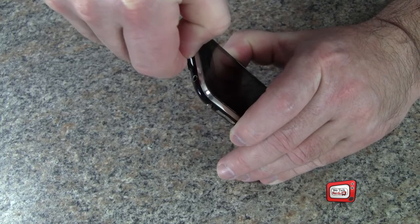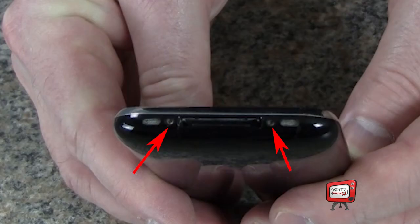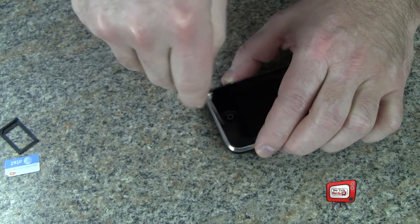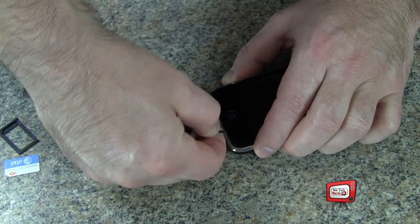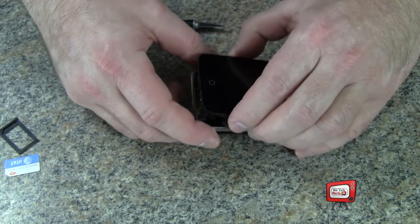Before you begin, you should back up whatever data you can. If you normally sync your iPhone to your desktop using iTunes, do that first, and then power the device all the way off. You start by removing the SIM card with a straightened paper clip — the SIM card holder is at the top of the device. Next, remove the two screws located at the bottom of the device, one on either side of the plug port. Using a strong suction cup, you can now separate the two halves of the phone. If you don't have a suction cup, you can slide an X-Acto knife between the chrome ring and the front glass directly above one of the screw holes. You'll need to exert a small amount of pressure to separate the display from the back panel.